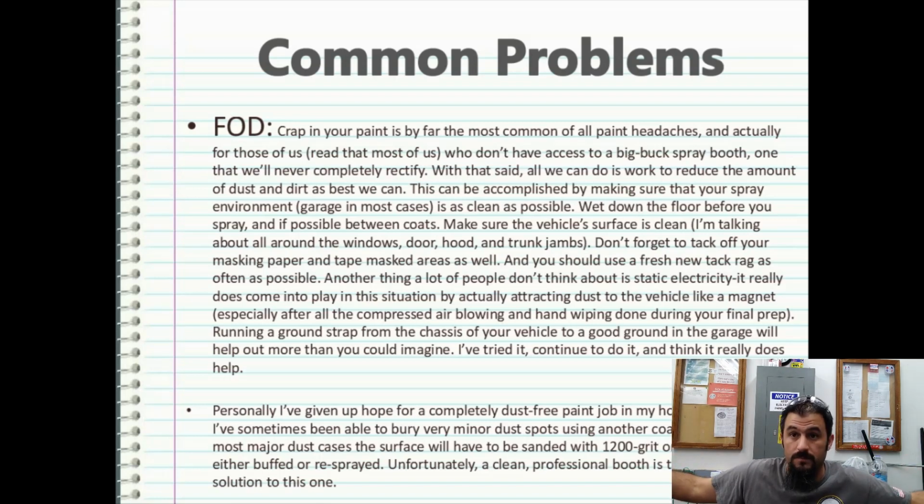I used to have a metal 10-foot by 4-foot paint rack. It was all metal, and I could slide airboat rudders, anything on there. I used to keep that grounded while I was painting. Back in my home-based business days, painting in a 2-car garage really sucked. But as I graduated to a full-time operation in Florida, I had a mobile paint filtration system. That thing worked great until the filters get clogged up and you have to swap them out. Either way, you want to go for a completely dust-free paint job because it's going to save you a lot of time and labor buffing the clear coat and trying to get that dust out.